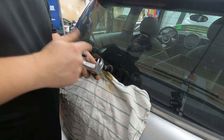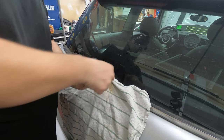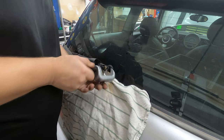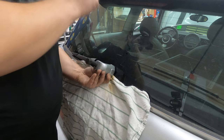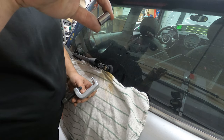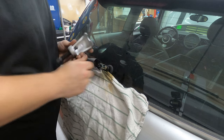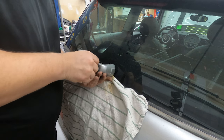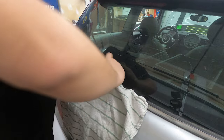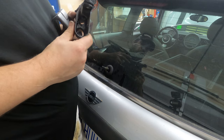I took a tool that's kind of like the wiper arm puller — it's a U-shaped tool with a cutout for it to go around the wiper arm. This is a front end service tool I have that works the same way. I put it behind the wiper arm at the smaller part of the base closest to the glass, and put the 10 millimeter socket over top of the shaft so we're pushing on the nut, not the actual shaft. Then I tightened that down and it pulled my wiper arm up off the shaft, so now we can remove the wiper arm.